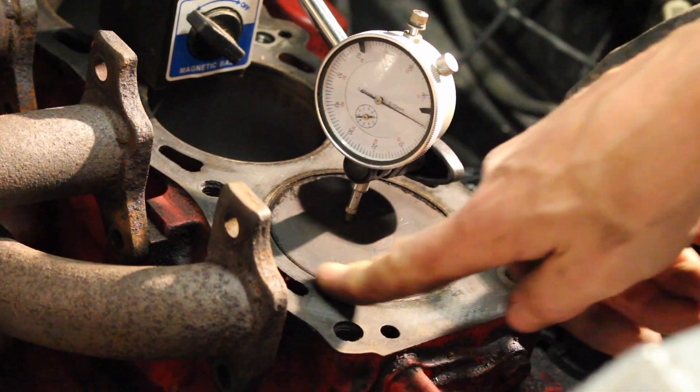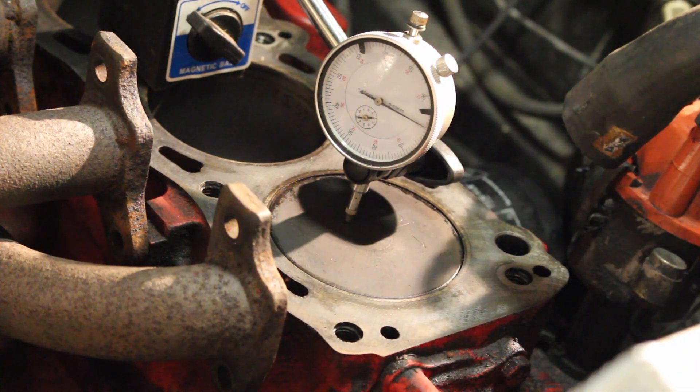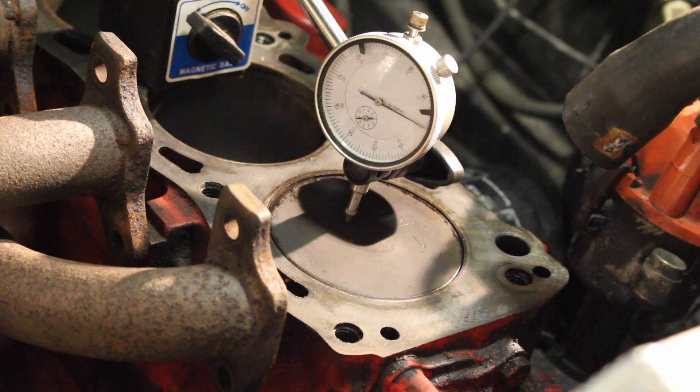We have found the highest point of our first cylinder, which is top dead center. You can then mark that on your pulley as TDC — put a score line on and hopefully use a reference point on the block to time that against.